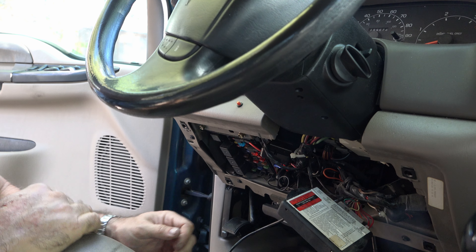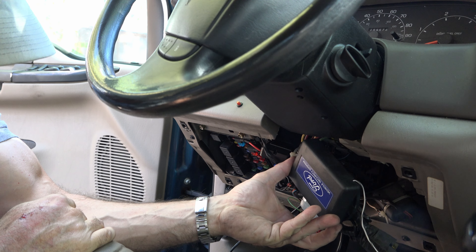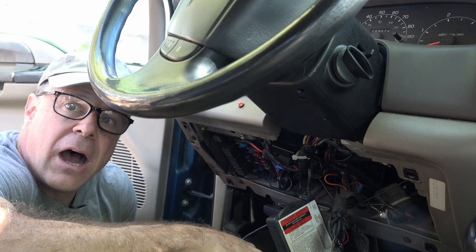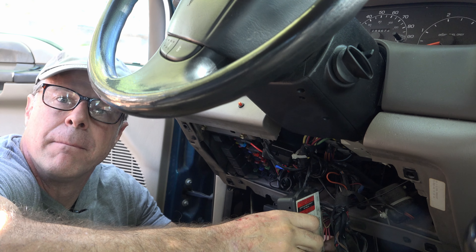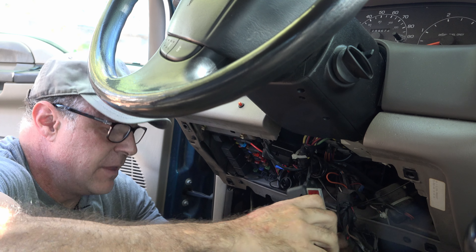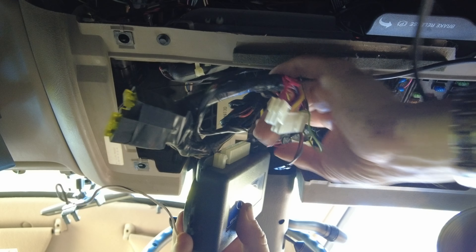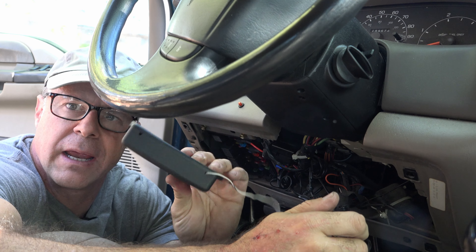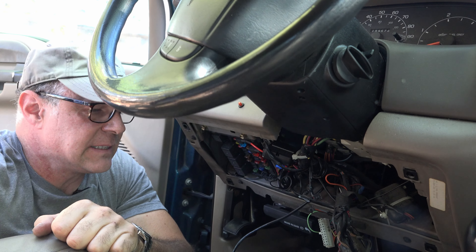There. That's going to expose all kinds of stuff. One of them is going to be this vehicle security system module here. Now, remove all the wires and the clips behind this box — pull out this wire, this wire, all of this. Just disconnect the entire system. Now you have a freestanding box right here. Put that aside.